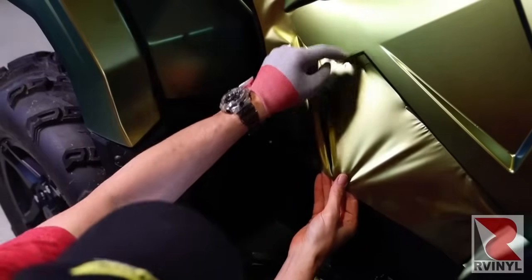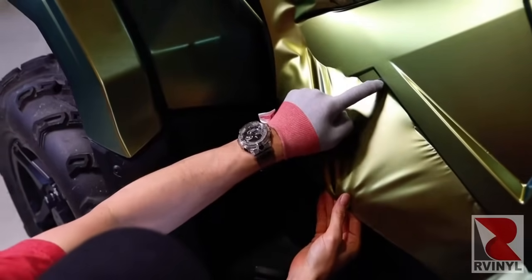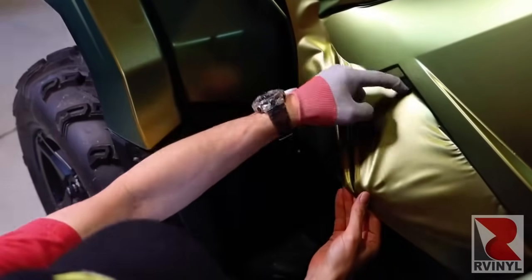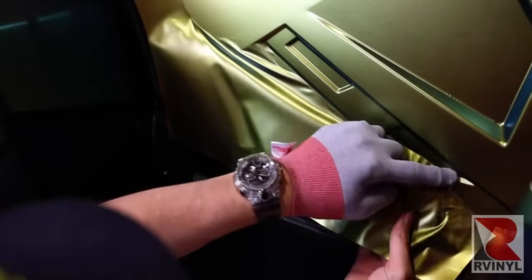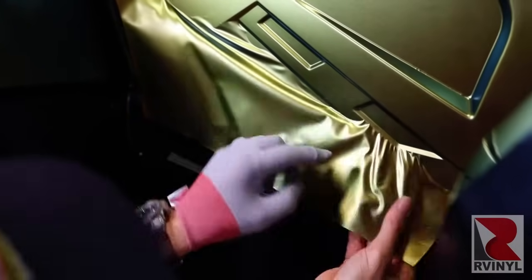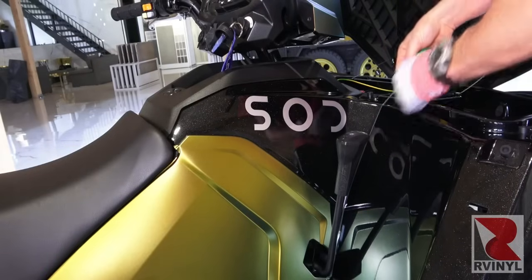And notice here, even on very tiny recessed areas, the material is picked up off the surface and then guided in with the application glove. This again neutralizes the tension on these severe deep recessed areas, and this really helps the material hold for the long term. And now we move on to another section, and knifeless tape is being placed on a transition point